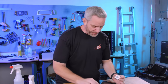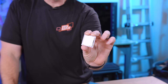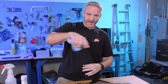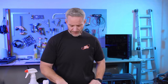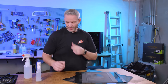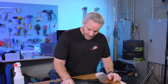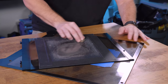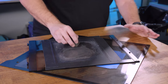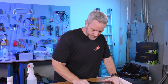This is already no longer an apples-to-apples comparison because this CPU has been lapped. The cold plate thickness gives us better heat transfer. You can see by where the copper is showing that this one was higher around the edges — not the center. Most Intel CPUs we found were high-spotted in the center, making them spin like a top on a piece of glass. This one doesn't spin because the edges were higher, so you could be fooled into thinking the IHS was fine. We're going to continue the lapping process to get more flatness out of it.